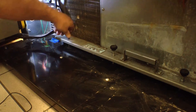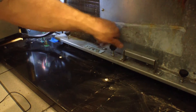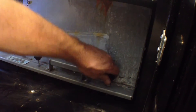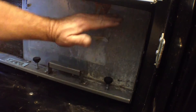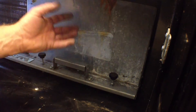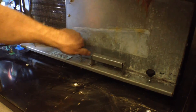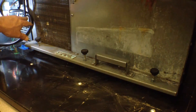You just loosen these knobs — lefty-loosey as if you were looking from the top — and loosen the knobs. As we loosen the knobs, the front end of this compressor is going to lower down, releasing the seal against the top, which is where all of our cold air has been going up. That will then allow us to pull the compressor out of its position once we disconnect all these wires.